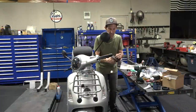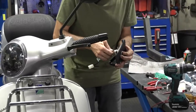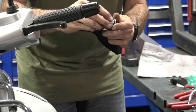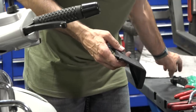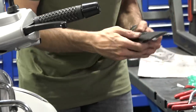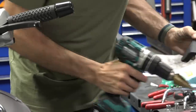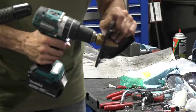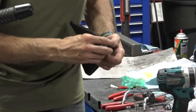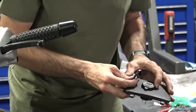I removed the knee pads. There was already an old Scooter West 12-volt cigarette lighter outlet — not too useful these days. I'm going to disconnect it and repurpose the hole for a USB charger — much more useful for phones and GPS that want USB-C or quick charge 3.0. The hole needs to be a bit larger, so I use a step drill bit, sizing it up step by step. Still needs to go up a step — there we go, I'm pretty certain that's the right size now. The USB unit fits in there nicely.